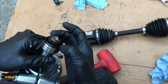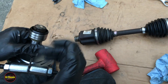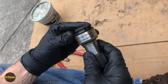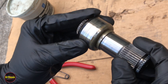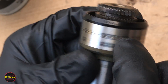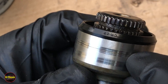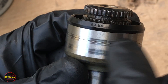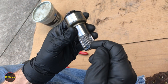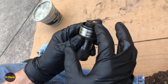There's another one of these snap rings in here that must have got lodged up. We'll pull that one off, replace both of them, put this back in the transmission, and then stick the axle on there. Now we've got those split rings off — so why are we having to rebuild this? If we zoom in really close, you can see how the seal on the transmission has cut deep grooves into this steel sleeve, which is going to lead to leakage. Since we've already got it off, we might as well replace it. We have to replace these split rings anyway.